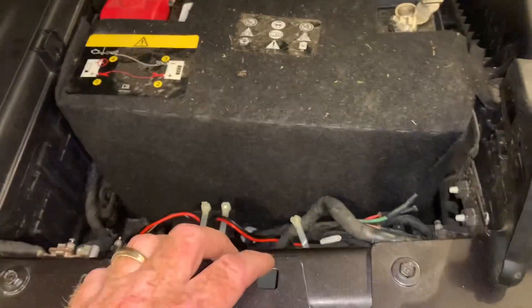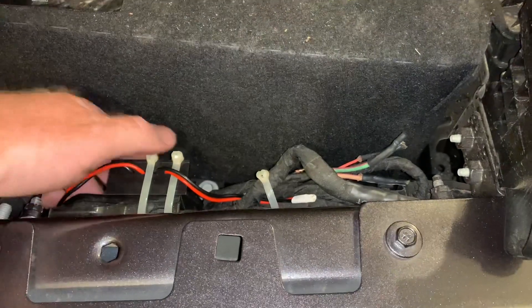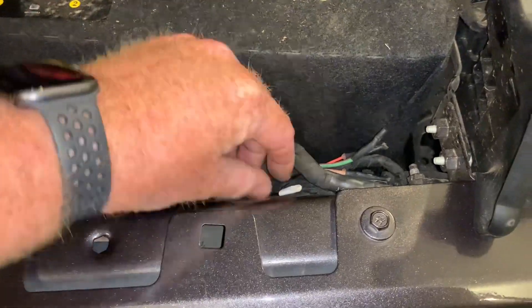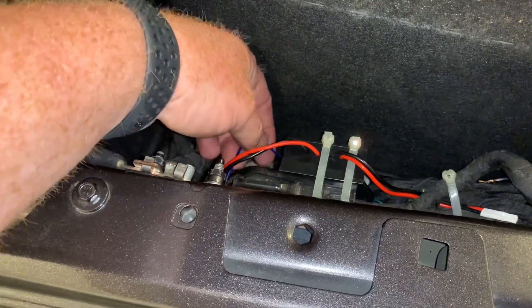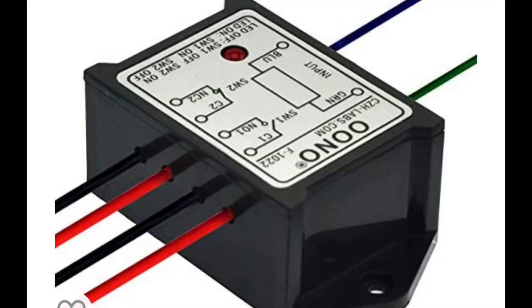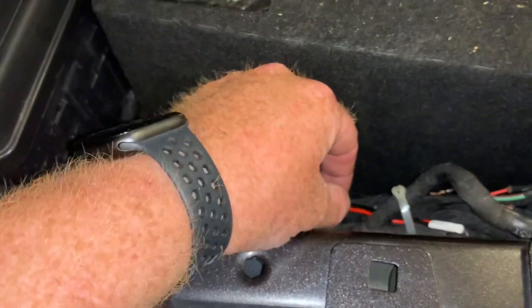Now you may be wondering how I achieved that. If you have the Aux switches in your Wrangler 4xe, in here beside the battery, there are four wires and the owner's manual tells you which color wire does which. I used the number four Aux cable to activate, to power up this dry contact relay. There is a negative wire and a positive wire to this relay — I'll put a screenshot of that relay here in the video. There is a normally closed loop and a normally open loop. If you aren't familiar with electronics, this may not be the project for you.